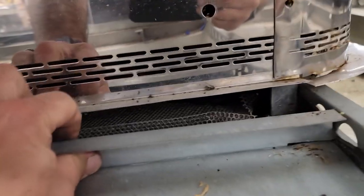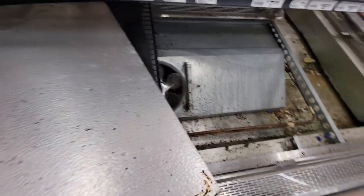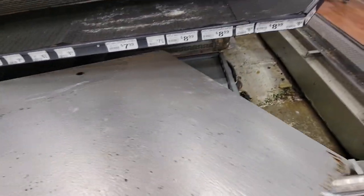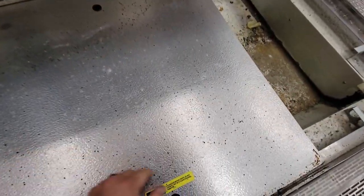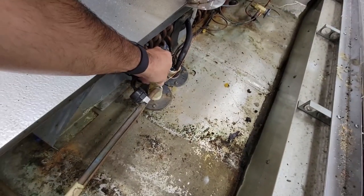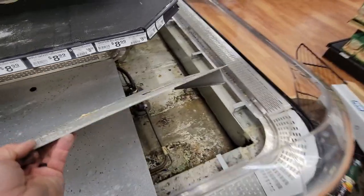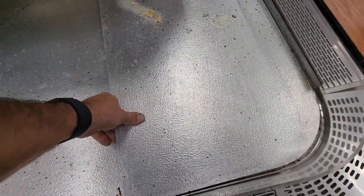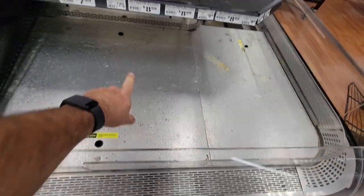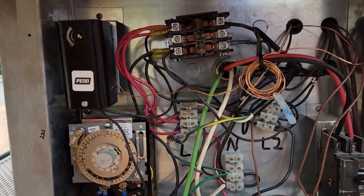He's able to pull the bulb back and get it further up into there so it's not right beside the coil — that should help get a more even temperature. The brown stuff you're seeing is sesame seeds and some bread crumbs; it's not mouse droppings. We'll get this back in there and seal it back up with some old silicone — all that does is keep the air as it gets shoved up through there from falling out and getting pulled back.